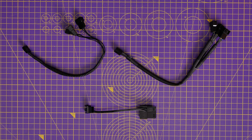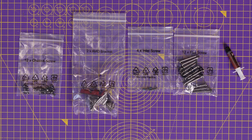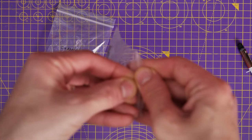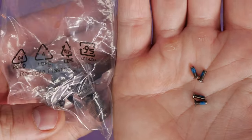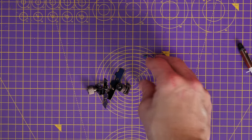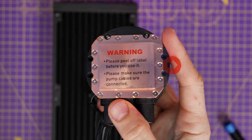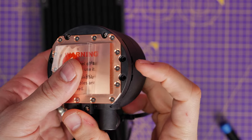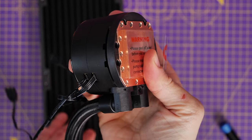There are various different cables here which have different uses. You have two different splitter cables for your fan power connection, which I'll talk about in a minute. These are the screws we're going to need: chassis screws, fan screws for the radiator, four tiny Intel screws, and the AMD brackets. Those tiny Intel screws connect the bracketing to the pump head. The brackets you can see here are what you'll use to connect it to the motherboard — they first need to be connected to the pump head itself, where there are slots and holes on either side of the sticker area.